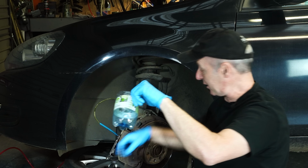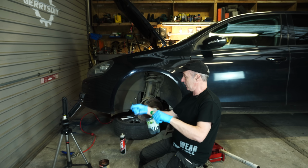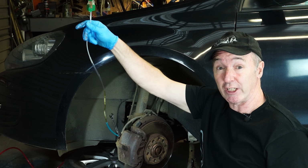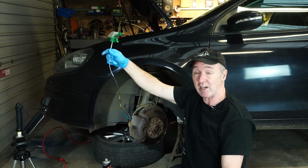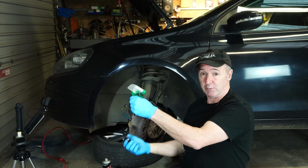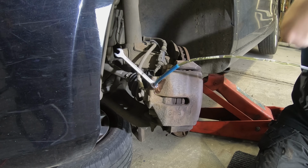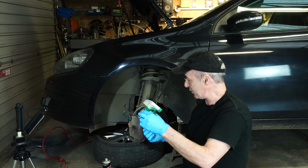And that's it. That's how long it took to bleed the brakes. I'll just tighten that now. You can see the fluid, I'm sure, and the bubbles. Now I tried the grease, hoping that it would stop the bubbles going in. There are other ways of doing it. I could put PTFE and stuff like that around the thread and lightly tighten it back in. But it doesn't matter, because where it's sucking the bubbles in is after the brake cylinder. They're coming in after the brake fluid happens.